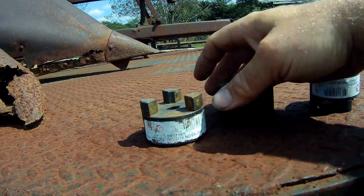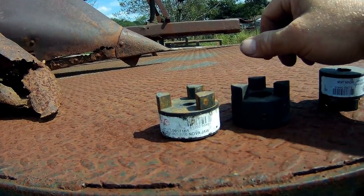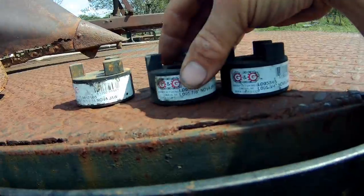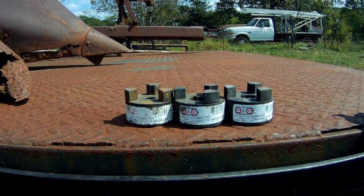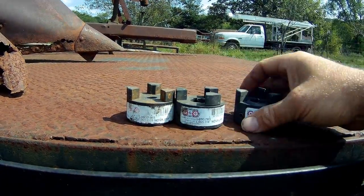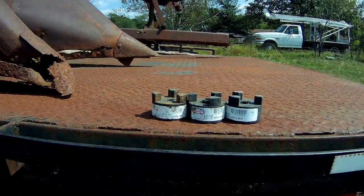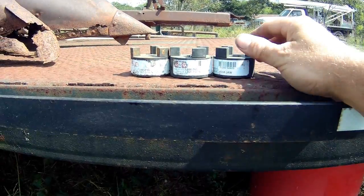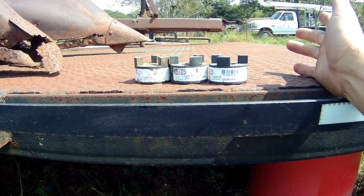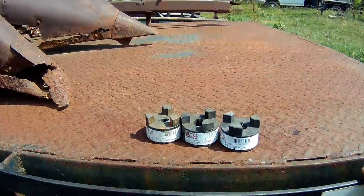That is how you bolt a regular lawnmower engine — Kohler, Briggs, Kawasaki, whatever you can get your hands on — to an outboard motor lower unit and build yourself a little four-stroke air-cooled mud motor. These little pieces are the key. Put the rubber spider on the bottom one, flip it, line it up, and there you go. They say Nova Jaw on the sticker, but I got these at Tractor Supply. Atwoods carries them, maybe your local hardware store does too — just depends on your area. You can always get them online; just measure your shafts.